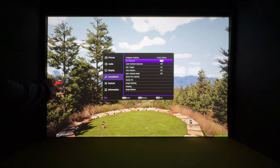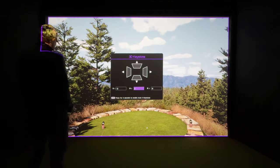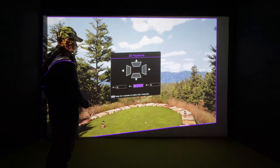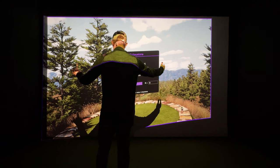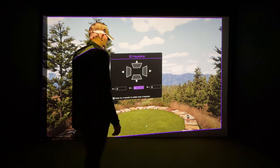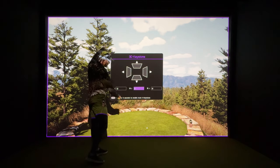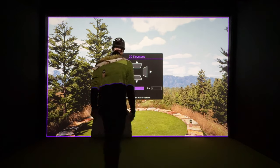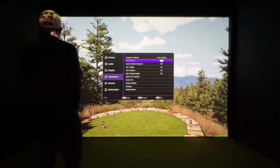After vertical keystone, you do the 3D horizontal keystone. We weren't off to the side much so we don't need a lot of adjustment — my bottom and top lines are pretty good. But if the projector were off to the side, you'd see the image skew and then correct it back. In short: vertical keystone handles the side lines, horizontal keystone handles the top and bottom lines.